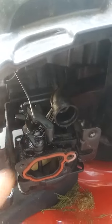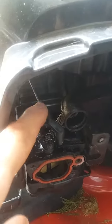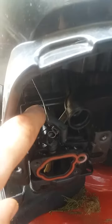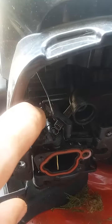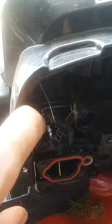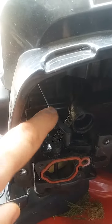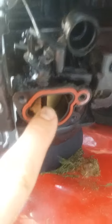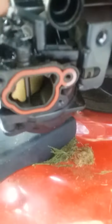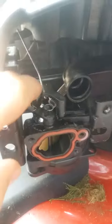So I pushed it back. I thought it was just gummed up in here, sprayed it with carb cleaner, cleaned it up, got it working. But every now and then I'd pull it out and it would stick, then come back, pull it out and stick again. So I took the cover off and just checked it out. I thought maybe the throttle plate might have been hitting something. Looked in here, got it going pretty good, wasn't sticking. Came back, put the cover on — started sticking again.